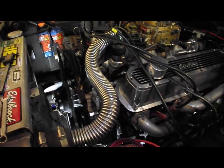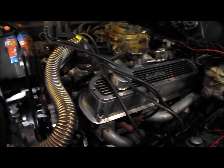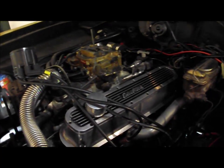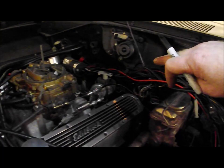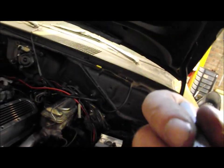Then what I'll do, I'll take the plugs out, crank the engine over, get the oil pressure up. I might reroute the oil pipe. You probably saw it near the accelerator pedal, it's badly routed. For some reason it comes over this side of the engine here, and then routes all the way down underneath the steering column, round the accelerator pedal and back inside to where the oil gauge is. So I really want to be going from here through an available hole in the bulkhead onto the gauge rather than this convoluted loop all the way around. So I might have a look at that, rework that.